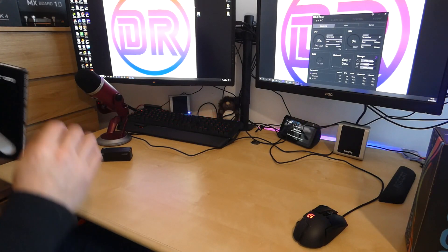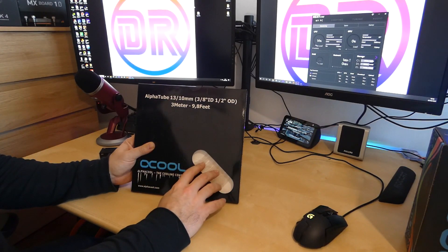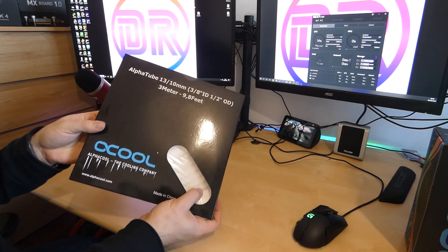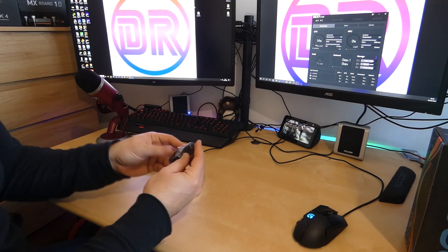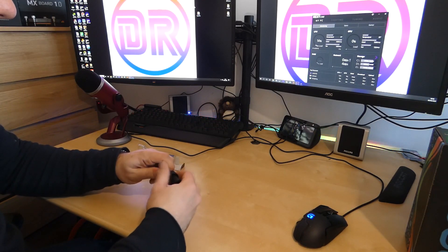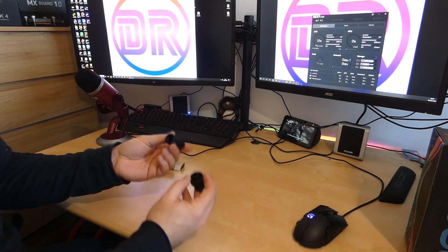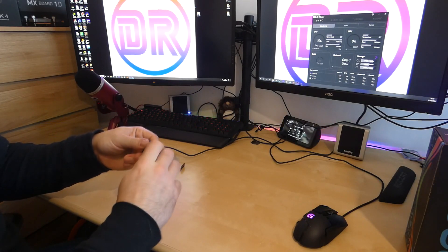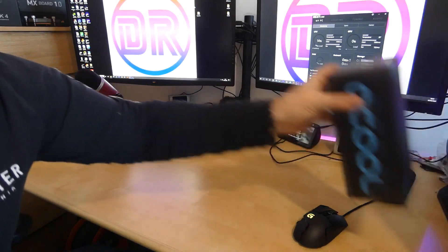There's also the Alpha tube, which is 13/10mm (or three-eighths by half inch), and you get three metres — about 9.8 feet — of it. They also include a quick disconnect fitting. This lets you attach a disconnect point into your loop so that if you decide to extend the system to include a GPU, you can literally quick disconnect it and add the new component into your loop in line, without having to fully drain the system first.